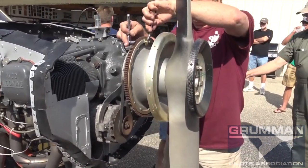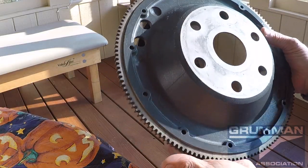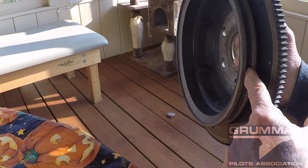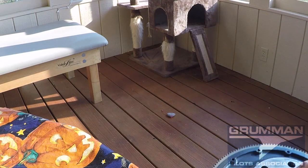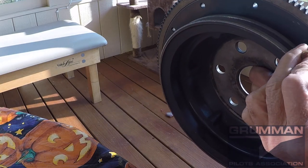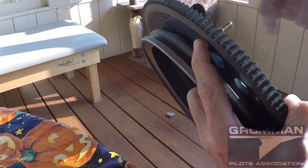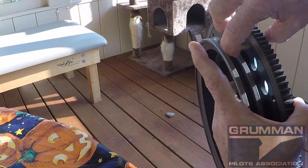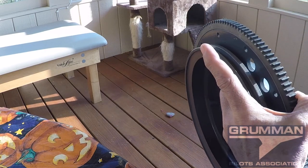Note that this math is only required on older systems. Here we have a starter ring gear assembly from the front of the airplane. There's a spot for the alternator belt to pass through the back. The bolts go on from the back side through those 12 holes, so all the weights end up behind the propeller without interfering with the belt as it swings through. Bolts always go in through the back side on the Lycomings.